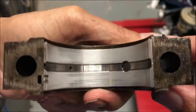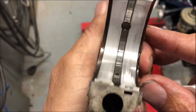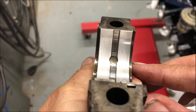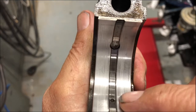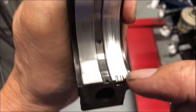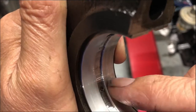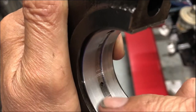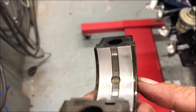There's a bearing and the big end cap. Again, you can see that it's not really very worn. It hasn't really bedded in. There's marks here where obviously it's rubbed, but there you can't see because it's shining. But really, the top surface of the original bearing is not really worn off, so these are just still bedding in. So I think this engine's been worked on recently.